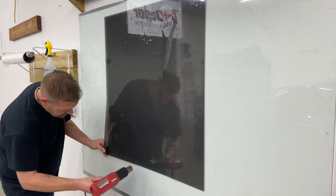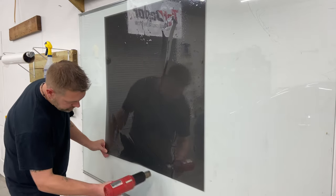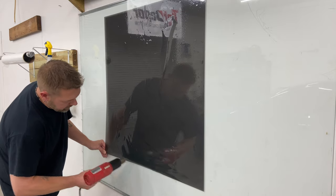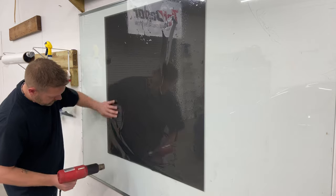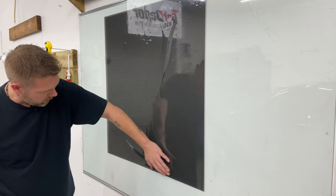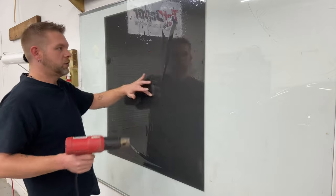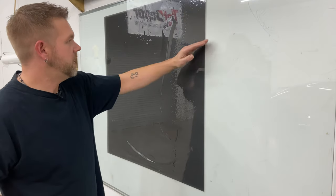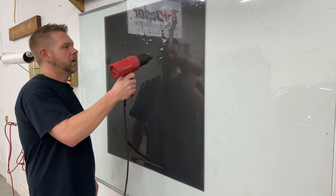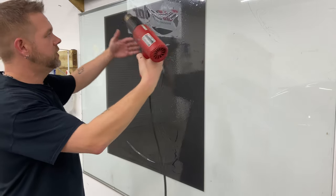So this is the factory edge — we're going to add a little bit of heat to the bottom here. Right off the rip, you can see where it's starting to curl. That's because it's pulling in and creating a curve. We're going to over-shrink it, we're just going to ruin this film, but you can really tighten this edge up and create a real curl on this film. Which basically is creating like a pocket to wrap around curves. You can see that line right there — this whole side of the film is shrunk. It has a curl to it, it has a curve. You can do the same thing up here. Here's a bubble just randomly in the middle — this is flat and this is flat, so it has no way to get to the edge, so it's going to pull side to side. You're going to see these horizontal lines. That's the film pulling into itself and shrinking. This is all shrunk right here.